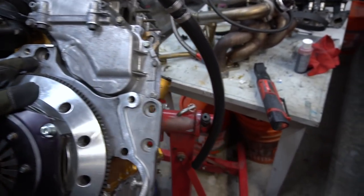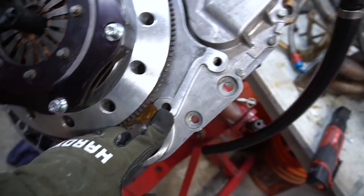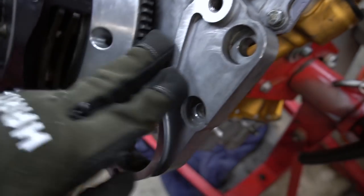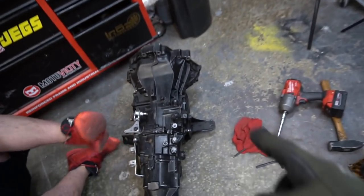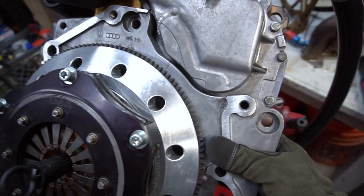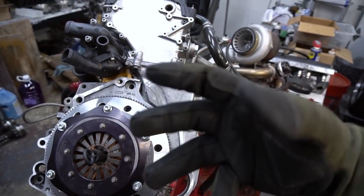I also want to talk about this bolt that goes through the frame — this one right here. So if you guys are doing the swap, check this out: there's a small bolt hole here that goes through the actual adapter plate and the actual casing of the bottom of the motor. On the back of the trans there's a bolt hole where you can put one large bolt going all the way through the trans, through the adapter plate, and through the block. That bolt keeps the motor and the trans from wanting to twist away.